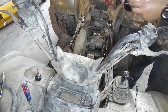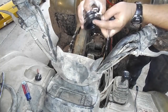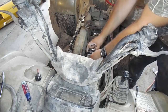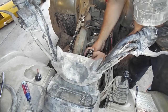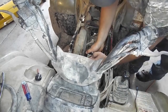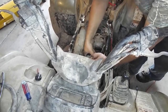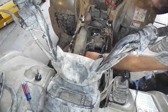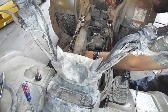First, we need to put our front hose back on. The carburetor I ordered came with a new one. If your carburetor doesn't come with a new one, that is okay. You can just reuse the hose you removed. This front hose has a groove in it. Make sure to line it up when placing it back on the four-wheeler. Once placed back on the four-wheeler, use a long extension and Allen key to tighten down the hose clamp.